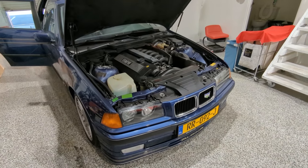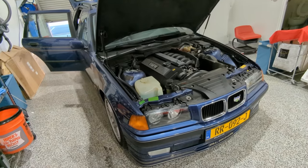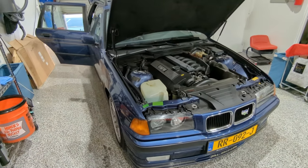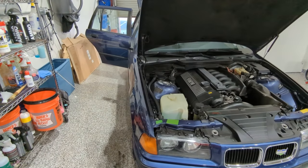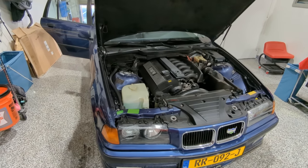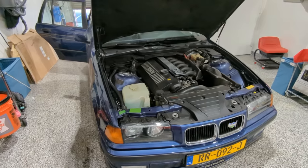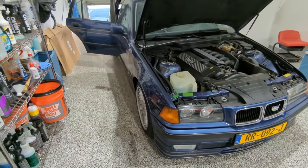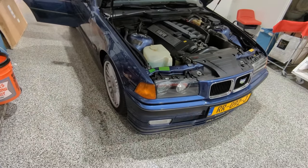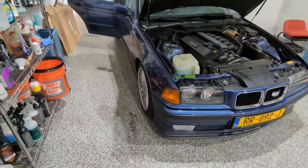So basically anything rubber in the suspension system, I will be swapping out and replacing. I believe there's also a fuel return line that is leaking slightly, because after a long drive when I park the car, it does smell of fuel from the back of the car. So I'm pretty sure one of the return lines is weeping fuel. That will have to be rectified as well. The brake lines on the car, I believe, are also original. So 25-year-old rubber hoses, those will all be replaced.